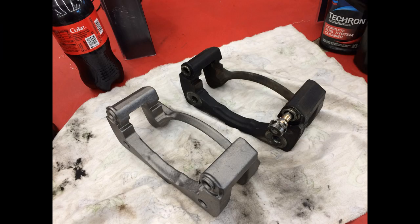Here's the bad caliper pin. And here are my six dollars worth of parts for my caliper pin extraction tool: three-quarter inch galvanized washers, a three-quarter inch galvanized coupling, and a bunch of three-eighths inch washers. Use the bolt that comes with the caliper pin and you're able to remove it. There's a picture of the old caliper with the slide pin stuck in it, and there's a picture of the new bracket.